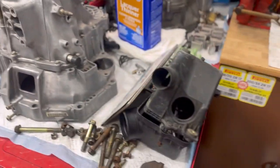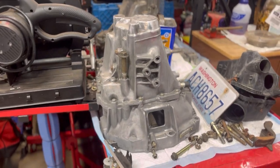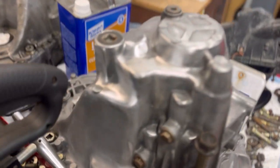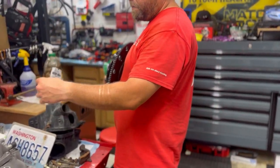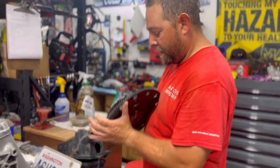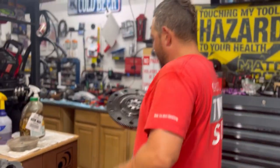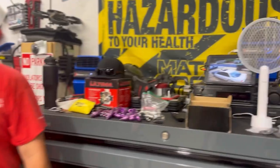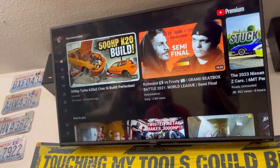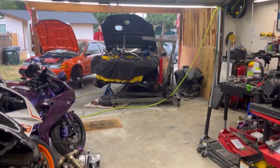It's an S80 — this is an LS case or a B18 case, right? It's a GSR. He took it apart because he wanted to know what was inside and Brian Spiker signed it. It's got carbon synchros one through fifth and he put an M-Factory LSD in it as well. Then this is going to be the clutch that goes with it — Competition Clutch twin disc. The guy used this and put about 900 miles on it. Over there — 500 horsepower turbo K20.